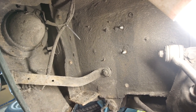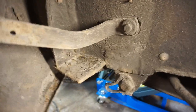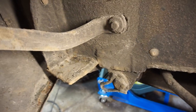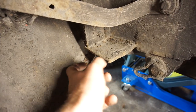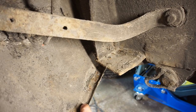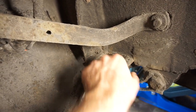It's actually a good thing to see where dirt collects, because where dirt collects you'll have moisture and probably rust. A common place on these cars is up here where dirt collects — there was a thick cake of dirt here that I got off. Down here there's a little surface rust, so my next plan is to get a scraper, scrape off what's left of the old underseal that's letting go, and treat that rust.